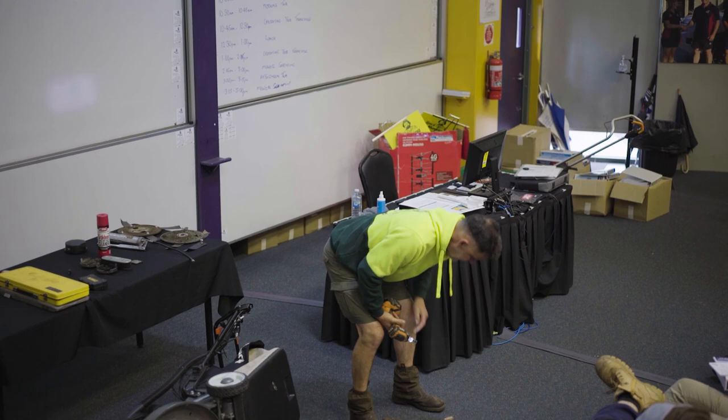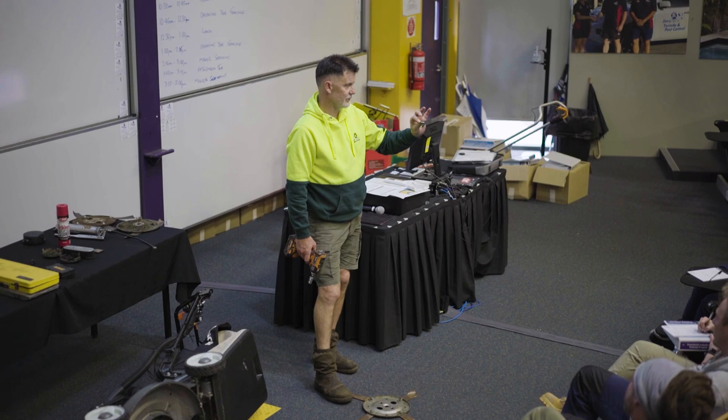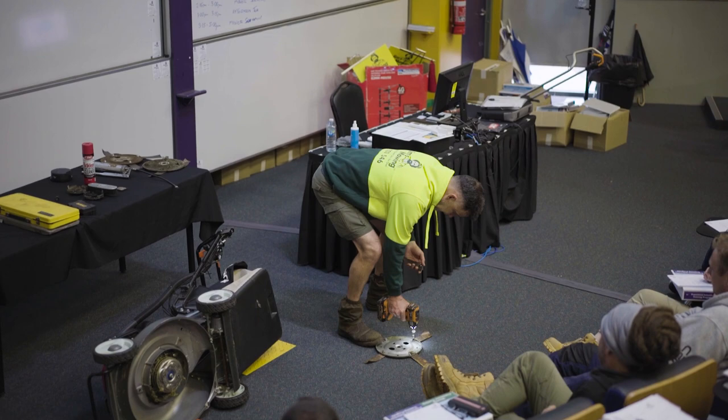So when you change your blades, new blades, new bolts. Okay? It's what they recommend you do. Bolts get compromised as well. You don't want a blade flying off, hitting you in the leg, or God forbid anyone else, or going through a window or whatever in the side of the car. So change the bolts.